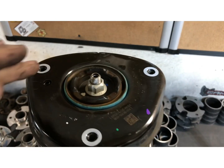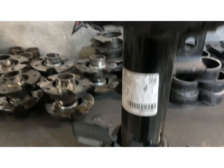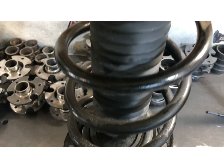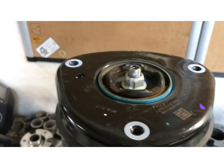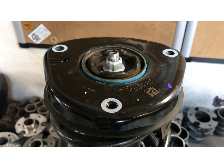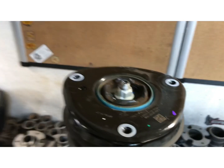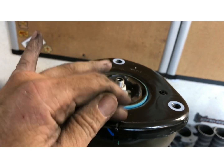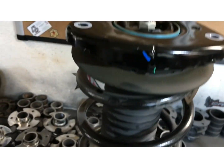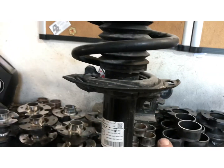So when you take your strut off, the two farthest spread bolts right here are going to be in line with the spindle, like right here. The way I made the upper spacers is I rotated them 180 degrees. So you're gonna have to turn this to line it back up with the top on the car. Basically you're gonna put this right here. So there you go, I just turned it by hand. This used to be here, now it's over there. This is the driver's side. It tells you it's the driver's side because it has a sway bar bolt bracket right here.